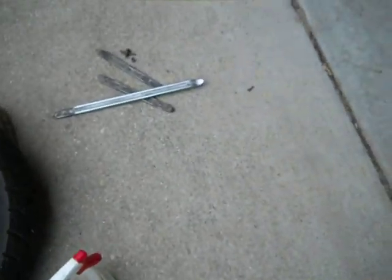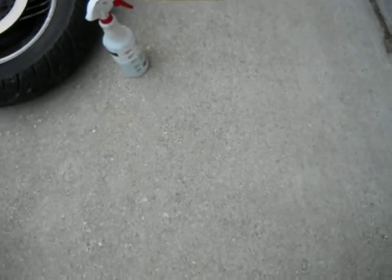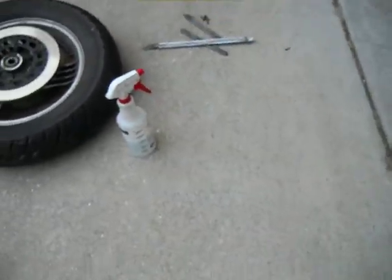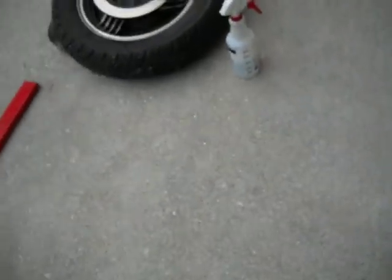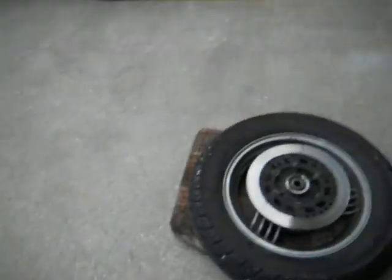Just moved the tire out, pulled out those doors. Well, here by the bead breaker, grabbed my spoons, my water thing. I use a sprayer, maybe put half a dozen, four or five tablespoons of dish soap in it, enough to make it suds. Comes in pretty handy. Okay, I've already pulled the Schrader out.